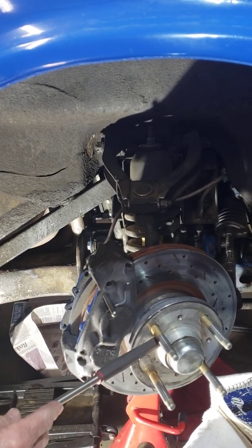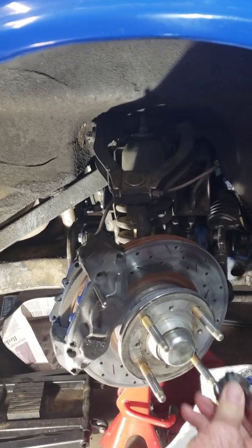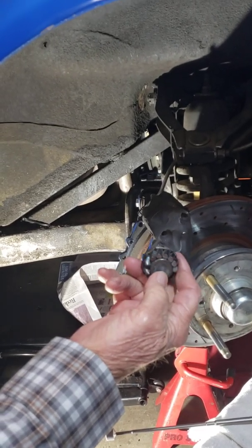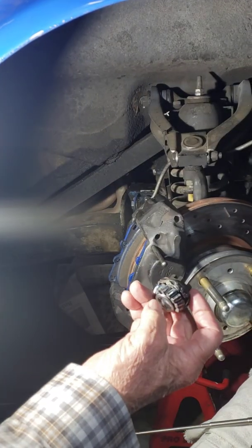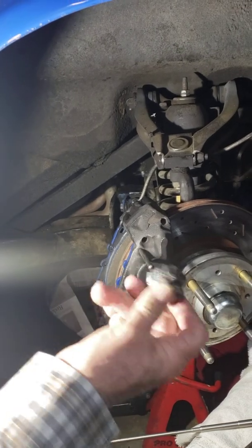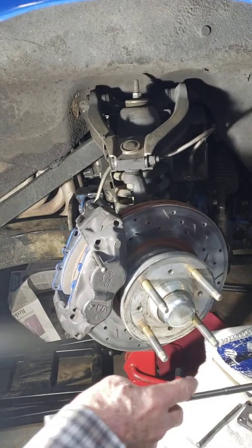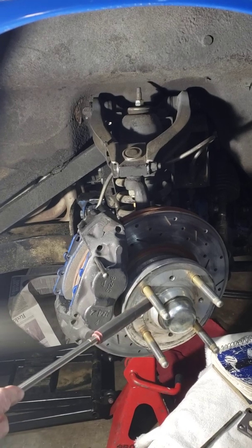What I recommend is you get the hardened spindles. Also, here's something that happened to me using a stock spindle: the bearings were well greased and adjusted properly, but they failed and welded themselves to the tip of the spindle, and they broke off. And there goes your wheel.